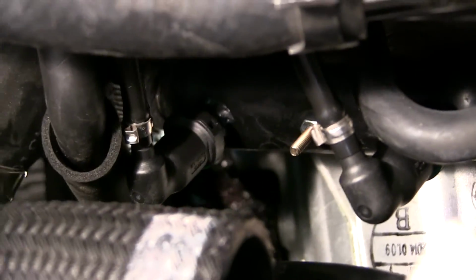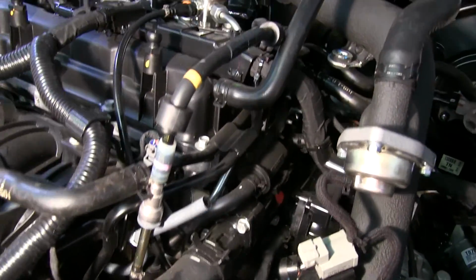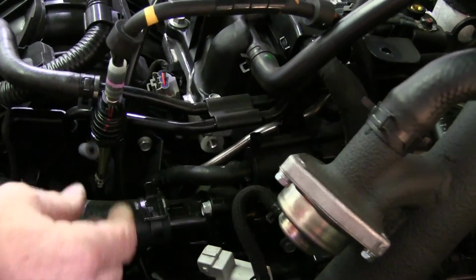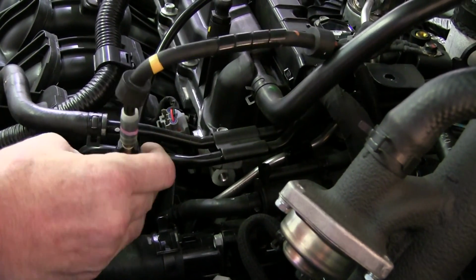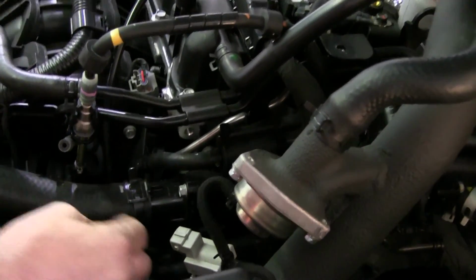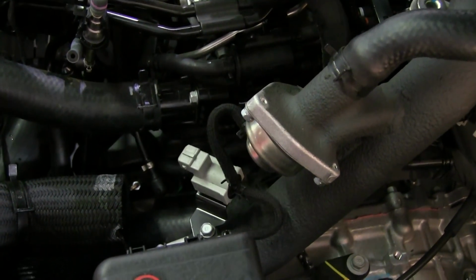Okay, and then the fuel line comes up. We've got our adapter, and that adapter runs straight back. That's the line that runs back to your fuel tank. And again, we're using the original OEM safety clip on the fuel connector to make sure that we're connected back to the factory onto that extension that we used. And at the moment, we're going to find a good ground, and then we're going to put everything back together and fire it up.